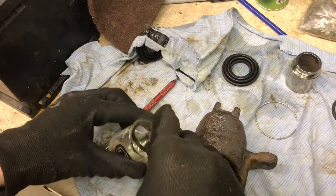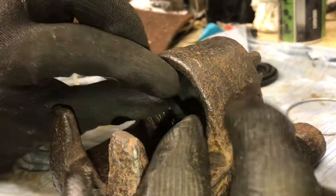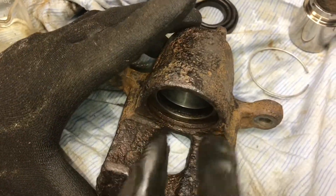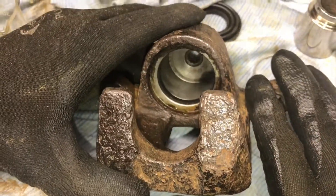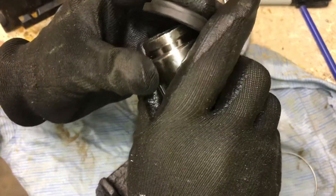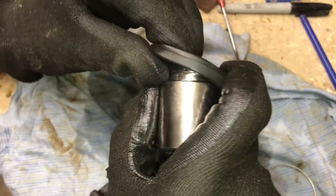We're going to put this new seal in — I'm just going to dip it in the brake fluid to get that lubricant on it, then go ahead and put the seal in place. It might be a little tricky, but I got the seal in real easy — I just squeezed it, moved it in, and maneuvered it around and it fit in there pretty easily. This new rubber seal here slides over the new piston — you want to be careful and just carefully work it around the piston, just like that.